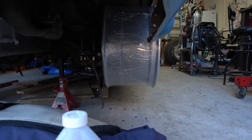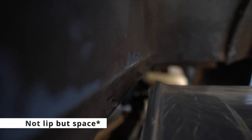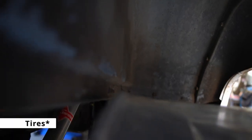Looking at the fitment from the back — that is a wide wheel and it's gonna look real good. The concern I had was it's just kind of snug. You've got probably about an inch or so between the wider part of the fender well and the actual wheel. I don't see it being a problem, but we'll never know until we put the wheels on. If I need to, I may tub the fender well right here because this lip sinks further back and raises out toward this side.